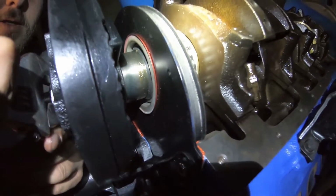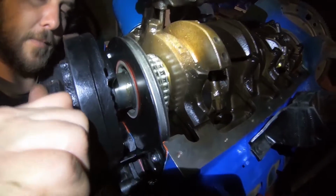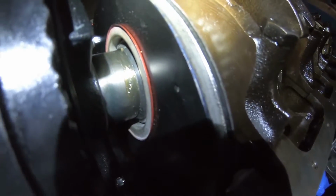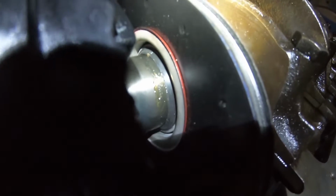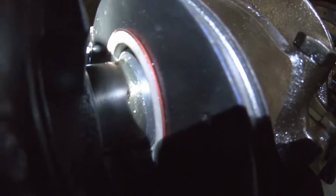It's just gotten dark, guys. We've lost a bit of time here. Just watch your hand there, and really slow is the trick. Once it starts rolling the lip like that, you just have to go real slow. Even though I'm doing this roadkill style, you don't want any oil pissing out the front of your timing cover seal.